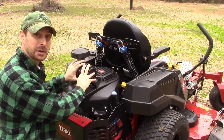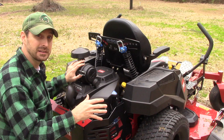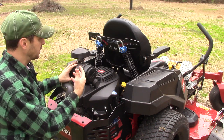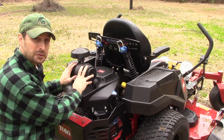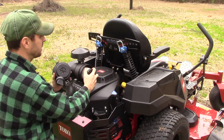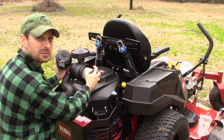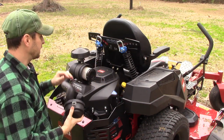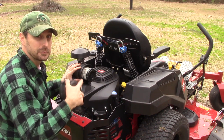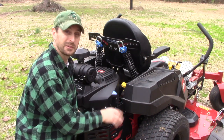I love this air cleaner — it's much bigger. I live in East Texas and it gets really dry and dusty here in the summertime. If you live in a dry, dusty area, there's a ton of dirt coming in and you don't want to keep changing out or cleaning air filters all the time. This is a commercial-grade air filter on a consumer model — easily taken out, easily cleaned and replaced. That is a huge addition to the 2020 and I absolutely love it. Toro also has their tool-less oil change system, which is always a benefit and really great to use.